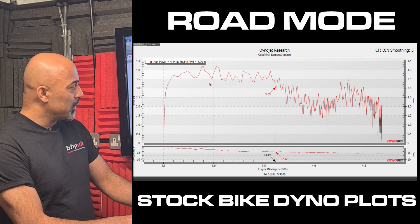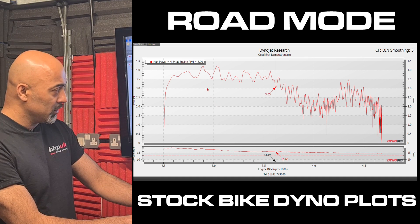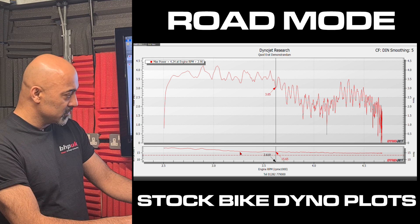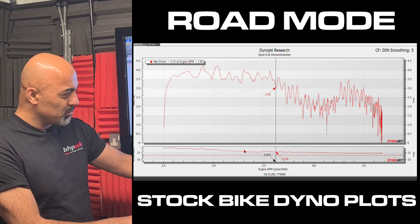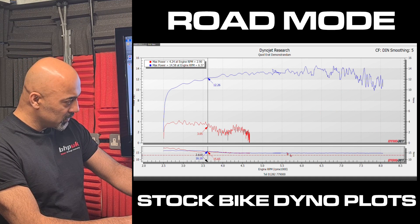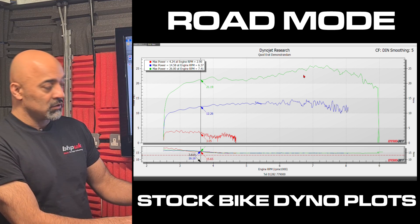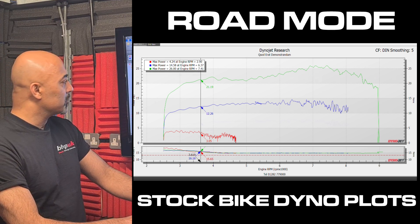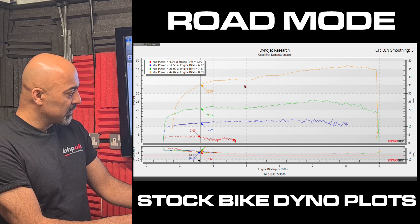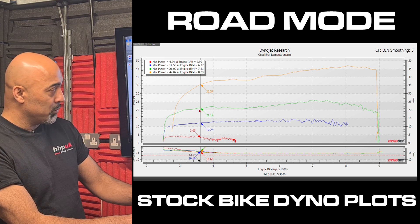The partial throttle openings are a different story altogether. Just got on the screen here — this is the power delivery curve at 10% throttle openings. As you can see it's very erratic. The reason for that is that it's running very, very lean. At three and a half thousand RPM it's at 15.65 AFR. At 20% we've still got the same problem with it running lean and it's still very erratic. 30% it's starting to get a little bit better but there's a lot of dips in it. At 40% it's getting somewhere near — the delivery's quite good but we've still got a little flat spot at 5,000 RPM that we are going to try and get rid of.